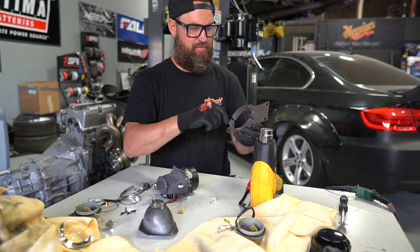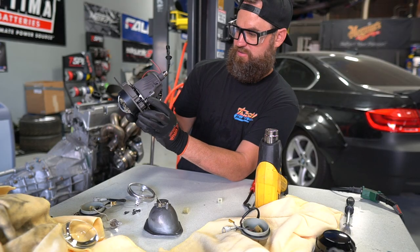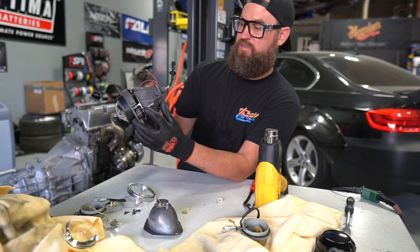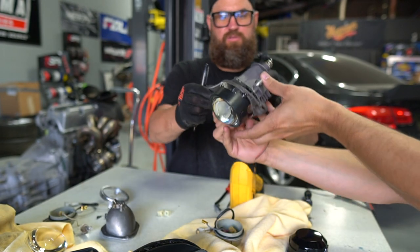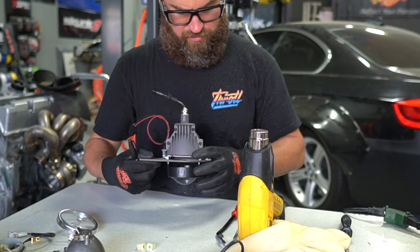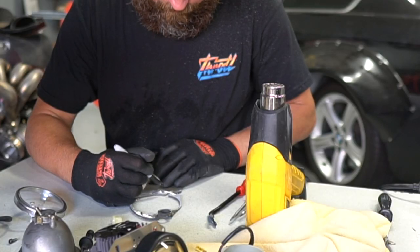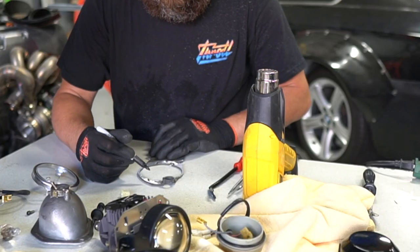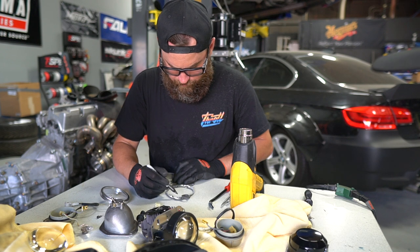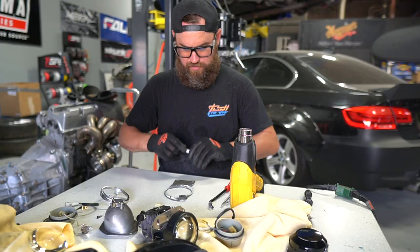If I zip off the rest of this material and just keep this flat — we just need those squares on one side and a little circle on the other. Almost every projector in a retrofit gets modified, every time. I would just marker it out, literally go straight from this, and then trace out your cut — make sure it looks centered. This is what people don't realize — this is what retrofitting is. This exact stuff right here. Most of the time somebody's already done all this for you and they've got little brackets and it's more like a bolt-on affair. But this is it, and I think it's going to turn out amazing so long as you get past the little obstacles. You've got the right tools for it — generally people don't and then they get stuck.